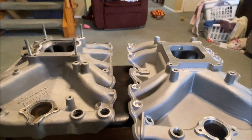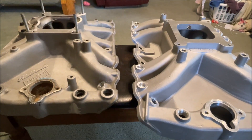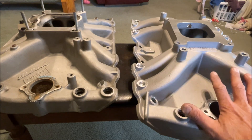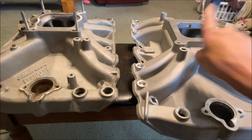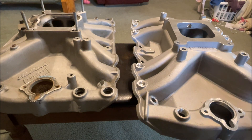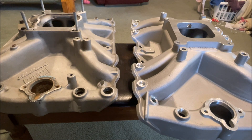These intake manifolds both are obviously not for maximum effort competition engines. My friend Ken Kirshner made a great point: you should build your engine and car to do its primary purpose the best. So if you're building a street car that you'll sometimes race, it's a street car first. My engine builder says he doesn't think the Speedmaster will be good for driving around on the street. I don't see how it's going to improve high-end performance either with a carburetor — maybe with fuel injection it would be great — but I just don't like it. I don't think you can weld that up, and if you did, I don't think you can get a consistent runner cross section, which matters for the harmonics that aid cylinder filling.